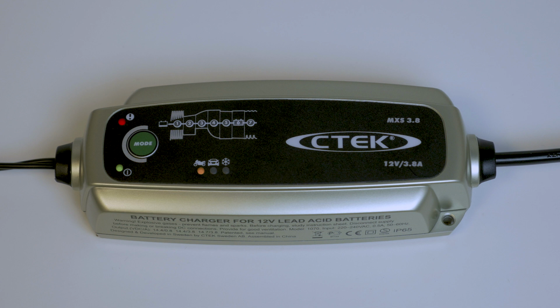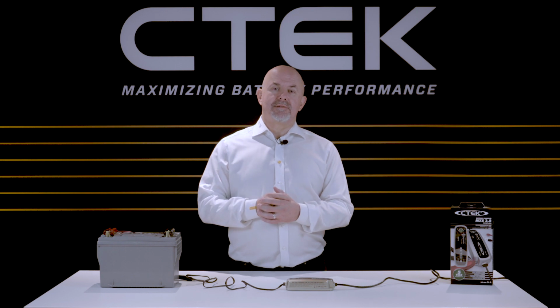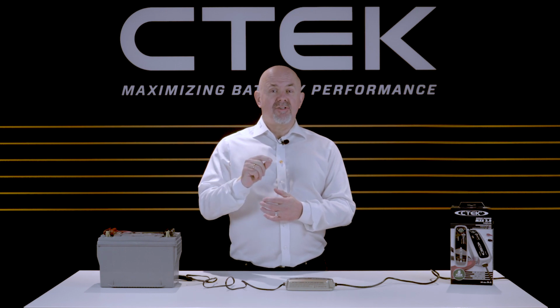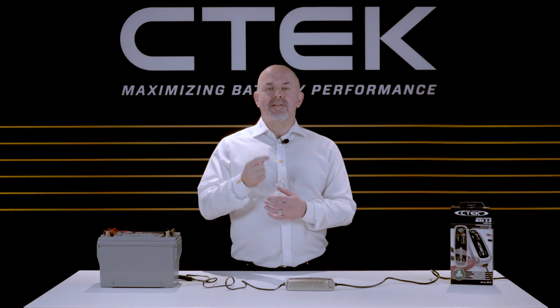If the charging process has stopped at the first LED stage, it means your battery could be seriously sulfated. If it stops at the second LED stage, it means the battery won't accept the charge. If it stops at the fifth LED stage, it means the battery can't keep its charge. In all of these cases, the battery might need to be replaced. If you're still unsure, try the charger on a battery that you know is working to check the functionality of the charger.